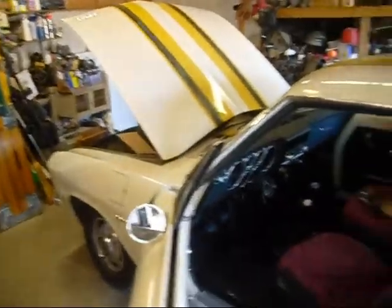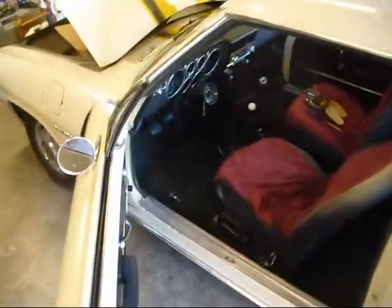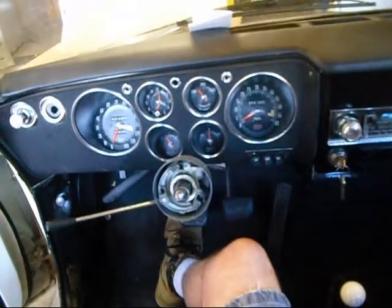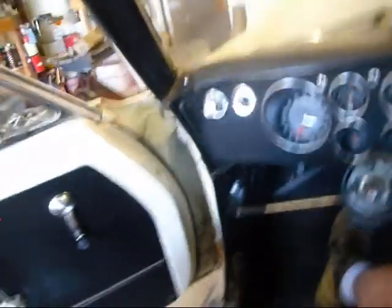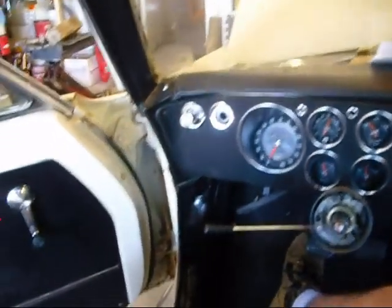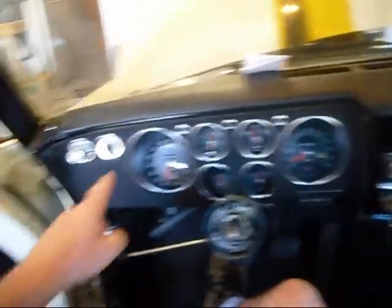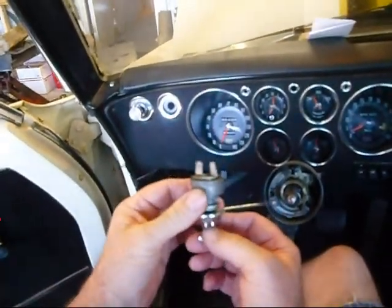What we got here is a beautiful Striper in for a little tune-up. I'm replacing the windshield wiper switch because the windshield wipers quit working. As you can see, I've got the steering wheel off because I'm fixing the turn signal that broke, and I'm also going to be replacing the light switch. Right now I've got the windshield wiper switch out and I've got a brand new one I'm getting ready to put in.